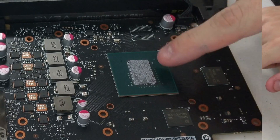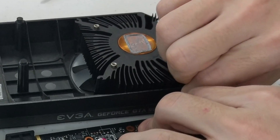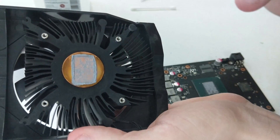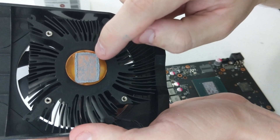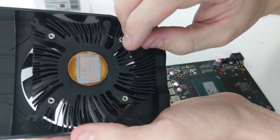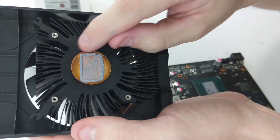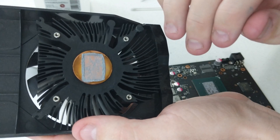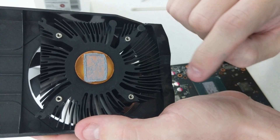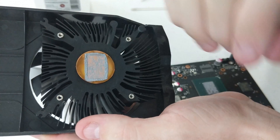Now, as you can see here, there's the GPU die and there's the copper plug. Let me just unplug this — it'll be easier so you can see it. If you look right here, there's a copper plug which is sitting in the middle of an aluminum heat sink. The GPU die is pressed up against this copper plug using thermal grease, and what the grease does is — air is a very bad conductor of heat. Little imperfections in the GPU die and the copper plate mean they're never going to make an exactly flush connection — there are going to be little pockets of air, and those pockets of air cause thermal conductivity to drop way down.